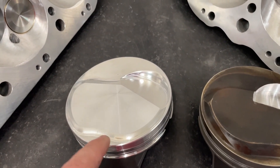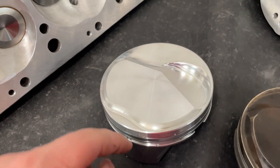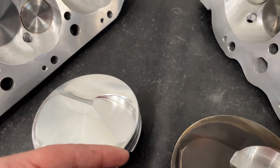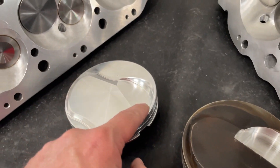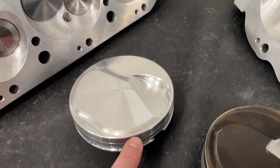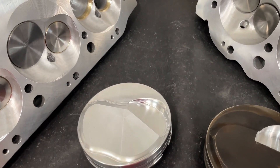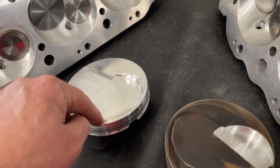When you get the Diamond piston out of the box, they have something called a vertical gas port — instead of holes drilled laterally, they're drilled straight down all the way around up top. Those actually work better for sealing because as the piston's coming up, it's forcing air directly into the back of the ring. However, on a street deal, carbon builds up and will block off those holes, making them less effective the longer it's running. The lateral ones don't get clogged with carbon. Some people run both vertical and lateral — I don't do that.